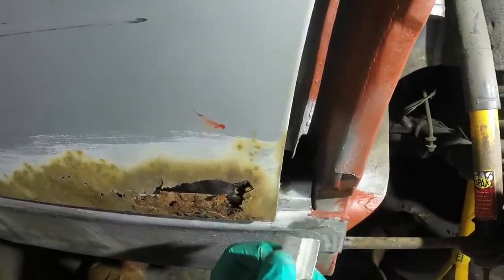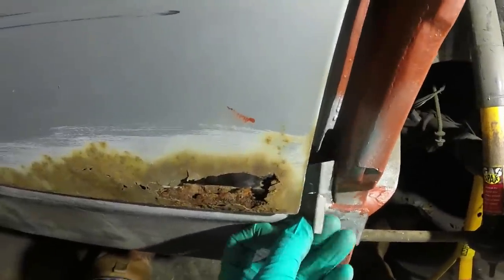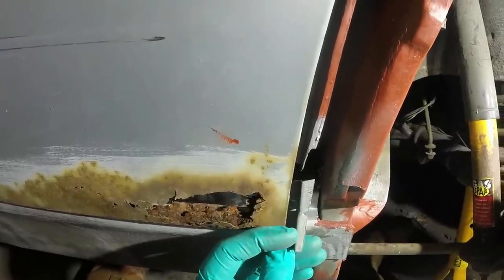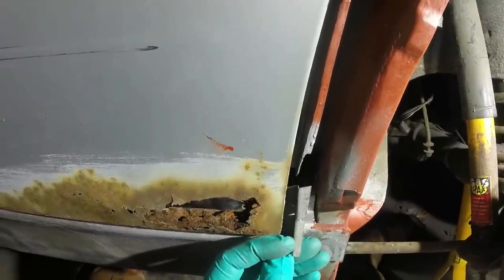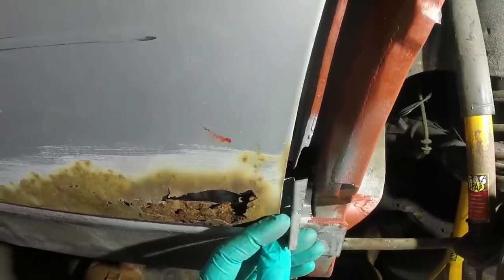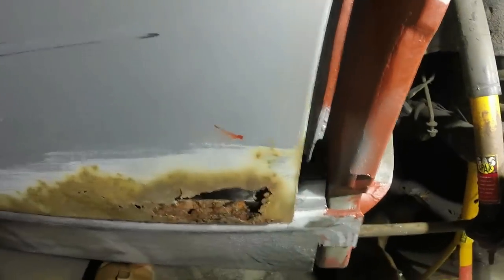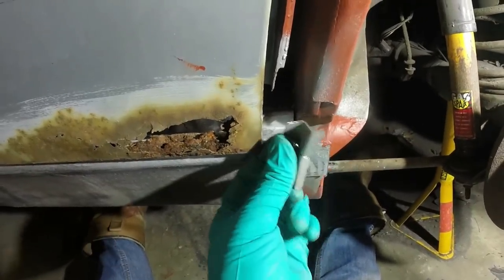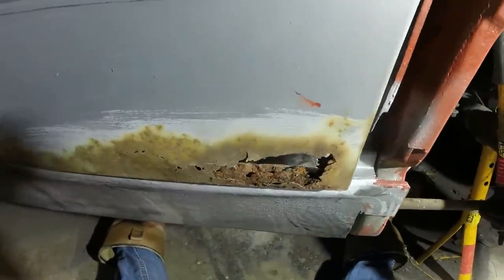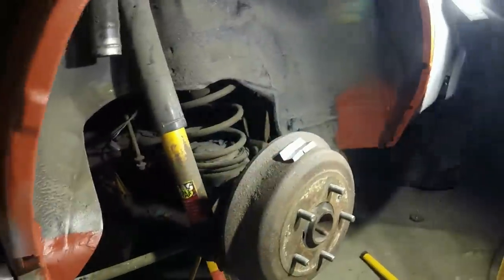And then I'll put this, which way around does it go? That way around. I'll move this until that edge is about 1 or 2 mil that way of where I need the end of the wing, so that when the wing goes on, which is sort of 1 mil thick probably, it ends up with a nice crisp line. So it's quite annoying how one little piece like that could really scupper you in terms of getting the whole of this area aligned, and it could turn what was a really nice repair into a really bad repair. And I will go and show you now what an incredibly bad repair looks like on one of these.